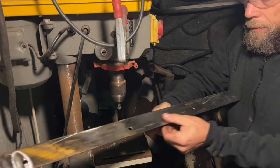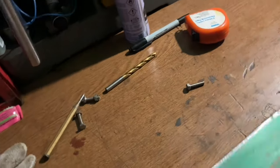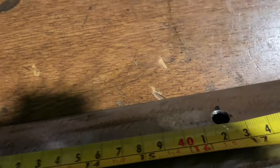One, two, three - done. Checking the measurements: I think I'm a couple of mil out. The centres are good at 207mm. Off camera I'll cut out the little step needed. 207 to the centre - yes. 207 and 420 - look at that, 420. I think I'm a little bit out here, but as I said before, the inner wings have got oval holes. That one's 635 - I am 3mm out, but that's here or there. 20mm centres - one for one, two for two, three for three. That's good.